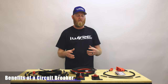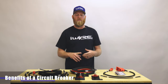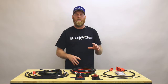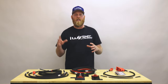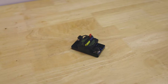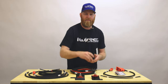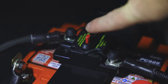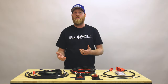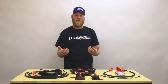Another key piece is a circuit breaker. A circuit breaker is really important for a kit like this because you need protection from your alternator and the rest of your harness and battery in case something happens on one side or the other. A nice feature of our circuit breaker is a manual reset — if you hit this button right here you can actually disconnect the battery from the rest of the car. So if the car sits in storage for a long time and you don't have access to a trickle charger, you can hit the switch and the next time you come to the car the battery will be fully charged and ready to go.